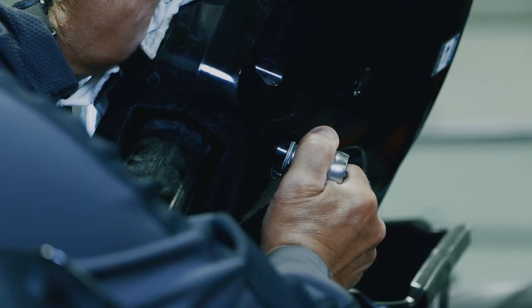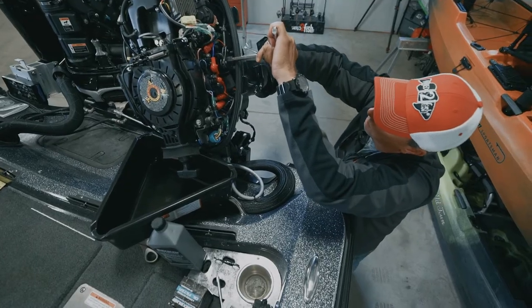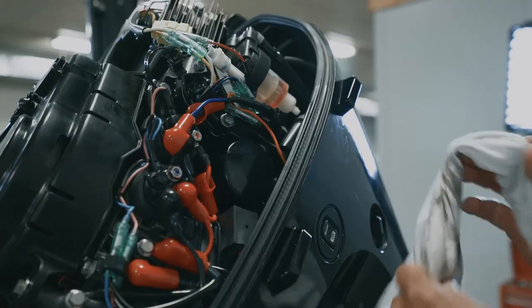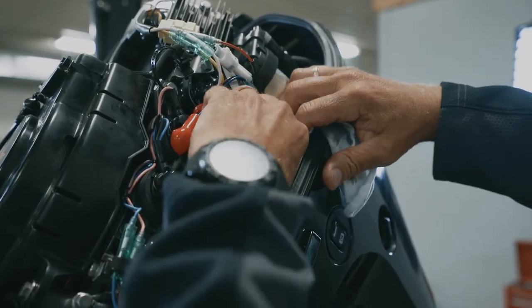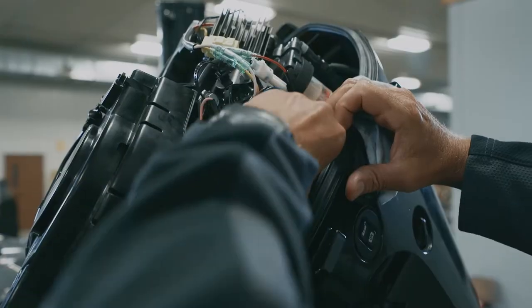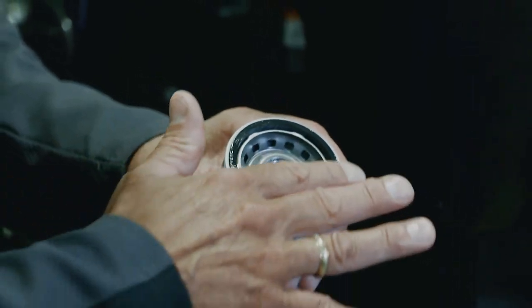Cinch that up with the ratchet and we're ready to complete the process. To remove the oil filter, put some pressure on it, and once it's loose enough, put a rag underneath there to catch any oil that may be left in the filter. Slowly unscrew it, allowing the filter to drain, and remove it.